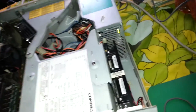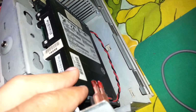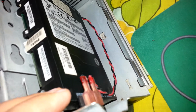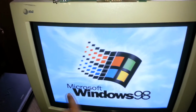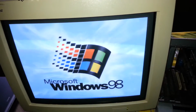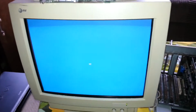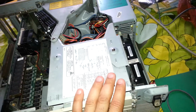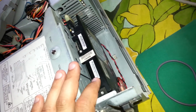Anyway, there is a problem with the hard drive, however. Last week when I checked, it had an error that the bad sectors were not completely isolated, and since we have the graphic right here, the red squares were right here in this area, and it will cause a lot of problems, and of course instability. So yeah, I think I'm going to have to try finding another hard drive on the SCSI interface, and see from there how it works. Probably if I'm increasing the capacity, it will not be seen correctly by the motherboard since it's very old.